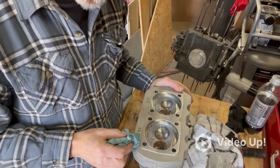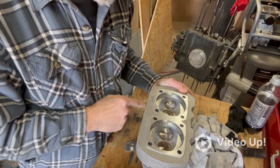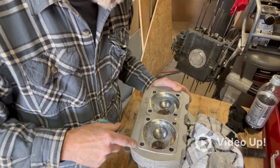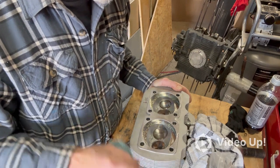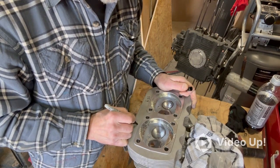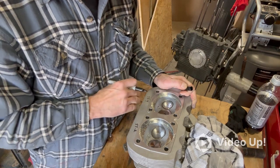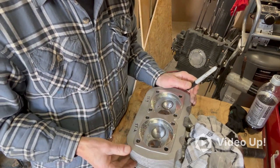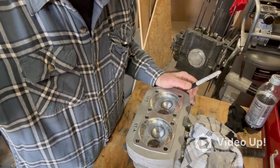So I measured the other side just to double check, and it was coming out a full cc less. So I double checked just to make sure, and I actually read the syringe wrong. This one's 55.4 and this one was actually 55.2. So they're within 0.2 of a cc, which I'm guessing is not too bad. I'm going to do the other side and see where it lands.